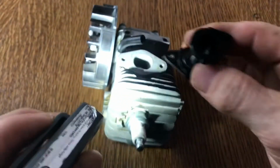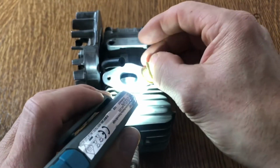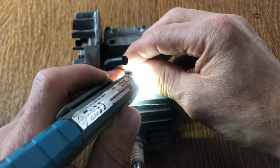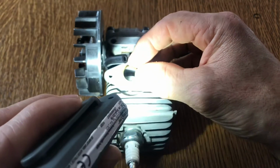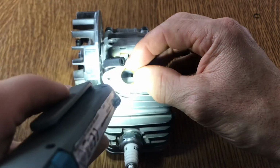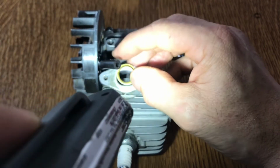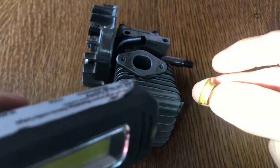So then what they've done, I'm not going to actually stick that on the rubber, stick it on the inlet, I'll just pop it here. In fact, I'll take that out of the way, you don't need that. So what you've actually got is that sitting there, right? Now, if you actually look inside there, it's massive. So what that is actually, must be some sort of restrictor. All I can imagine is that is some sort of restrictor. This thing here is a restrictor. So the first thing I'm going to do is take that out. I'm going to try and run it without this restrictor in there.